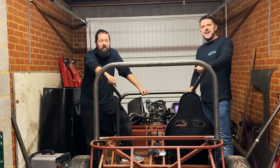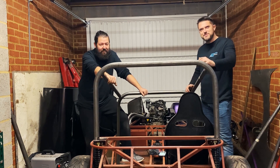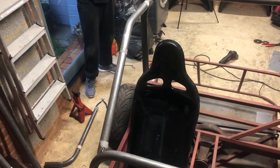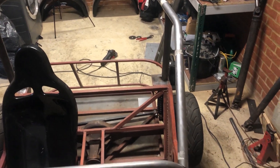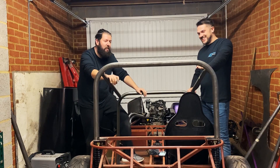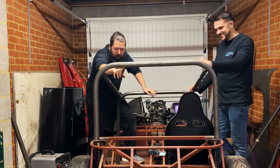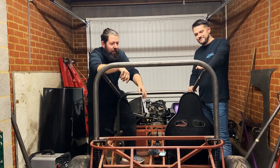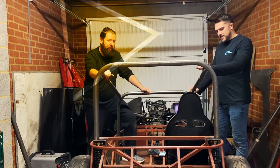So we asked you earlier: how hard is it to attach a roll cage to a race car? Well, it turns out it is pretty hard. We spent most of the day and basically tacked — loosely welded — four bits of metal together and to the chassis. But it does look roll cage-ish! We've still got to put bars down from here to the back, one across there, and then one from here down to here — just triangulating everything, because the triangle is the strongest shape.